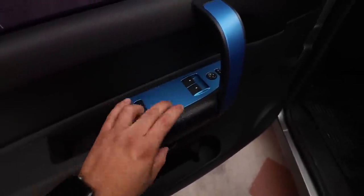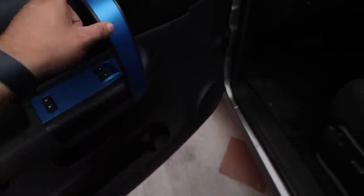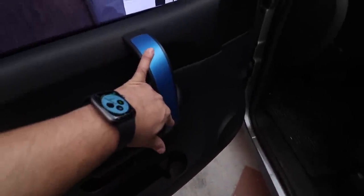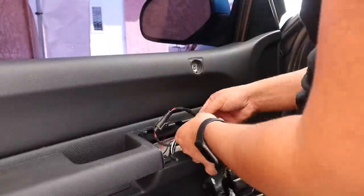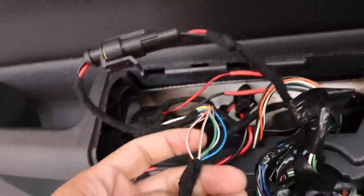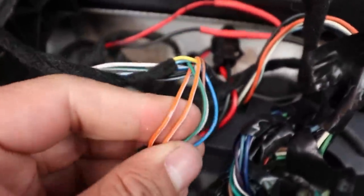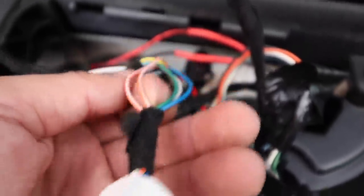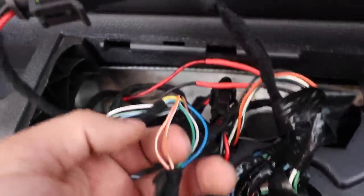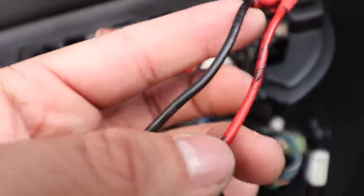Luckily everything should be here so we shouldn't have to take off the whole panel, because I put everything in this panel. All I have to do is take off the two 10-millimeter screws that are here, take this part off and then pry this up. We grab our white plug that comes from our side mirror — and these are the same wires here, orange with white, orange with white. It doesn't matter if you use this one for 12 volts or this one for ground, but you do need your ground and your power. I'm gonna be splicing it right here.